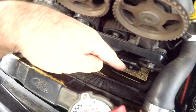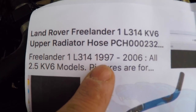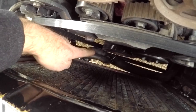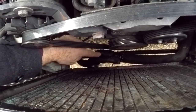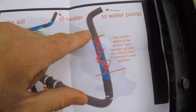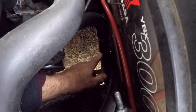For the bottom radiator hose, I've used a top radiator hose from a Land Rover Freelander — the K-series models with the KV6 from 1997 to 2006. I've had to do some modifications: it comes with a T-piece, but I had to cut this hose a bit shorter, and that goes into the bottom radiator port. This straight part of the hose I also had to cut a piece out of because it would have been far too long, and I added a hose joiner to connect the pieces back up. That end goes into the ZTEC water pump.